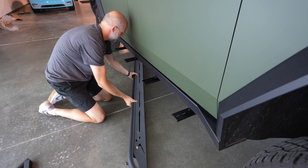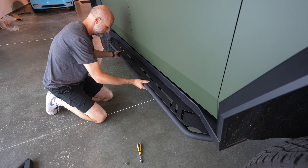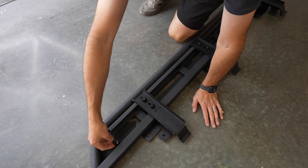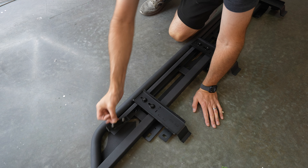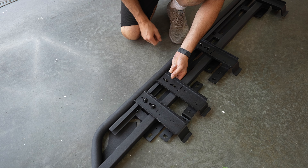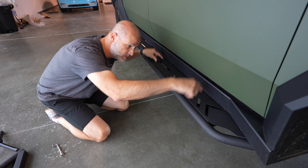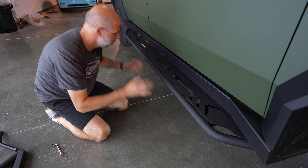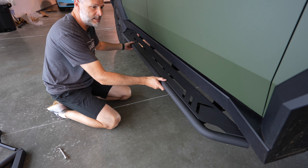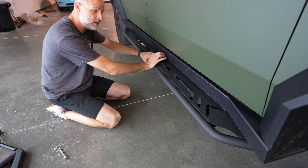Now that all the brackets are in place, I'm going to set the running board on top. Here's a shot of underneath showing how the brackets bolt on — it slides underneath and that's what gives you the adjustability. So the key thing I've learned: put the brackets in place while the bolts are loose so you can move them around more. This is all the way out — you can slide it down, slide it forward, so you have a ton of adjustability. You can push it all the way in for greater clearance, or move it out. From the edge of the car, you're at five and a half inches out, or just under four and a half inches when pushed all the way in.